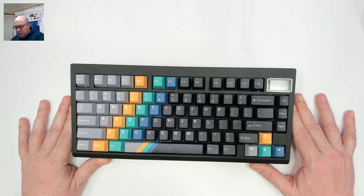This one is a little bit trickier. I hope I don't damage it before I get to put the screen protector on it. We can see the little magnets in the pocket for the 2.4 receiver. But we can see that we have your standard foam gaskets on the PC plate, and I'm not going to pull too hard because right there is the cable for the daughter board, and there is going to be the connector for the battery, which again in this one is another 3000 milliamp hour battery.